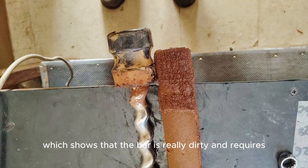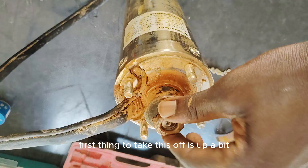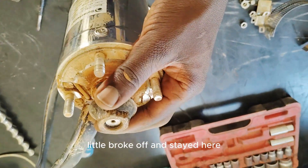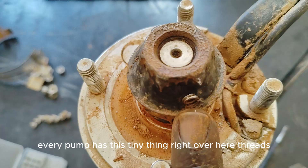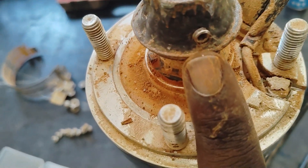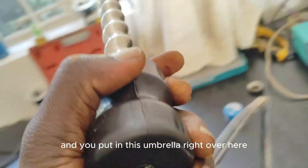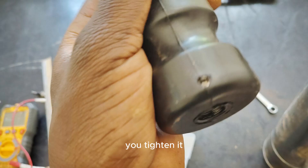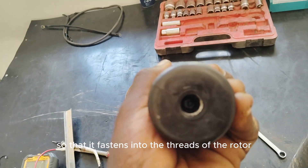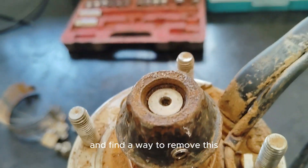That's a new one and this is the old one — really dirty. These require replacement, so I'll use these to replace them. First I need to take this off. This one literally broke off and stayed here. Every pump has this tiny thing right over here with threads — sort of like a seal. When you put in this impeller, you fasten it where there's a hole, and you tighten it so that it fastens onto the threads of the rotor so it doesn't come off. We need to first take that off and find a way to remove this.